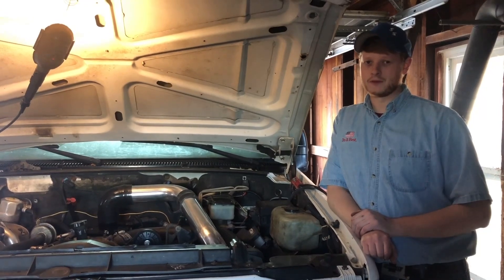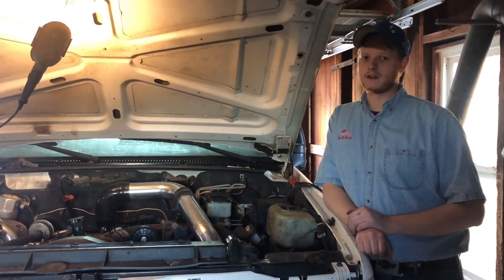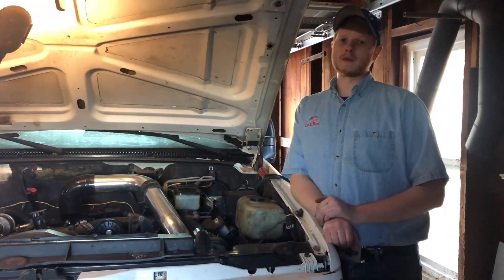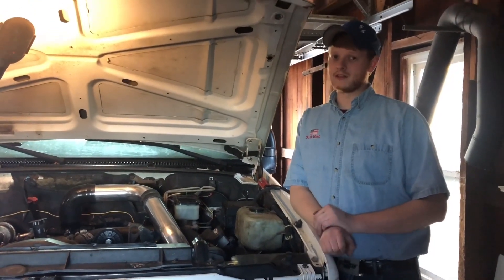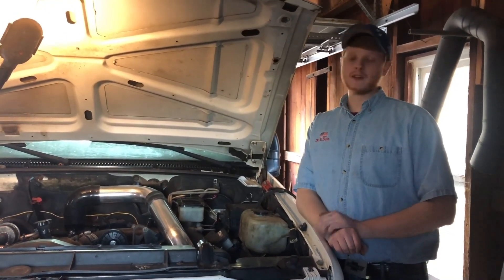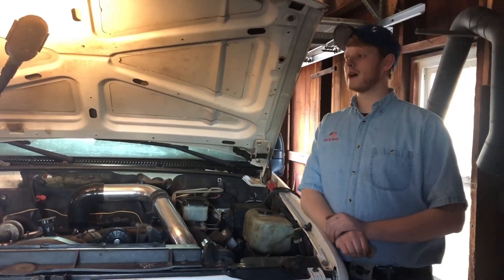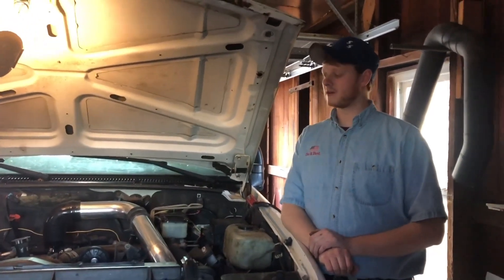It was a hill that was roughly 1,200 feet long by between 6 and 8 percent grade, which is pretty damn steep. I had it to the floor in first gear, going 15 to 20 miles an hour, with the EGT pegged at 1,600 degrees and the boost gauge bouncing off the 35 psi max pin. We still managed to drive another 500 miles before the gasket popped. So realistically I'm not terribly upset, but at the same time it's a little setback for our testing.